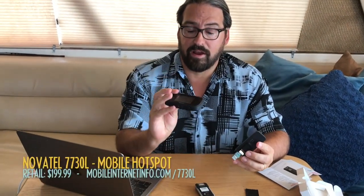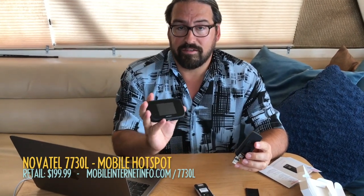That right there is kind of the key difference versus a mobile hotspot. This is Verizon's flagship hotspot, the 7730. It creates a Wi-Fi network out of the cellular signal, and then you can connect multiple devices to it, and you could also tether it to a computer over USB. This USB stick only works over USB — it only works plugged into a computer or a router, with no way to share the connection other than having a router do the sharing. But that means this is a lot simpler of a device and potentially has less things that can go wrong with it. And in particular, because it doesn't have a battery and is powered by whatever it's plugged into, you don't have to worry about the battery failing. Hotspots after a year or so are prone to having battery issues. So this simple little USB stick, just smaller and lighter, gives you an easy way to carry around connectivity for a laptop.